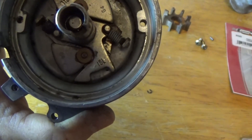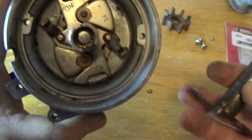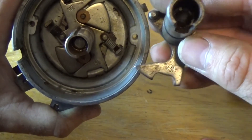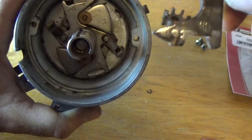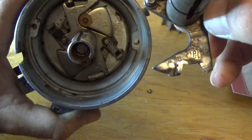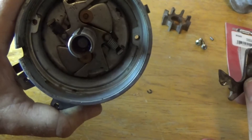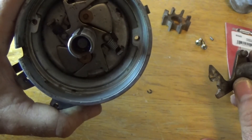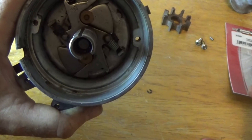In a case like that, go to the junkyard and find another one. This one has a '13L,' which gives us 26 degrees. This side originally had an '18L' — as you can see, I welded that up. That way if I need the 13L side I've still got it, but I know I'm never going to need the 18L. I welded this one up to 0.410 inches wide — the slot width for a '10L' — which gives us 20 degrees of mechanical advance. So I can set the initial at 16 degrees, plus 20, and come in at 36 total.